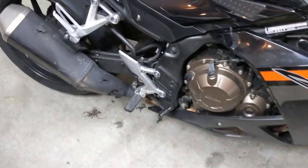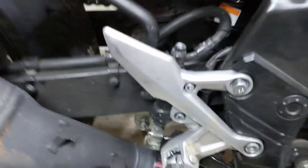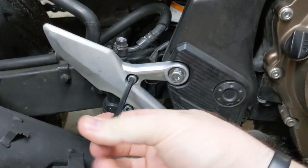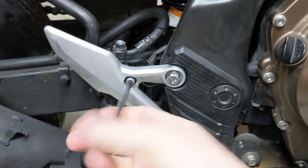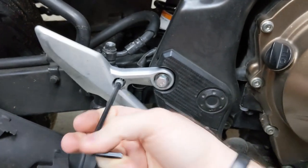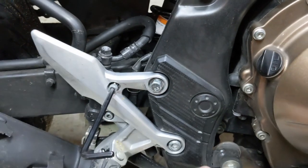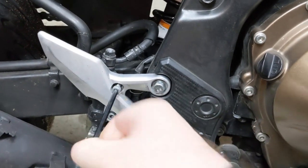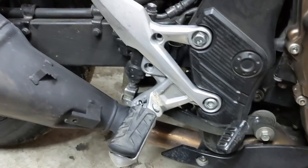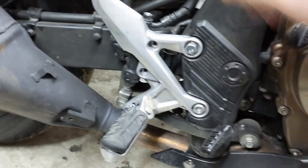The first thing — I'm going to start with the brake side. You'll need a 5mm Allen wrench or socket to take these loose. I've already started loosening mine just to save a little time. You want to take these loose first, because once you take these out, it's a little bit of a pain to remove these. Once you have those two bolts loose, the brake master cylinder will be free.